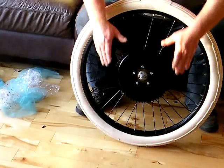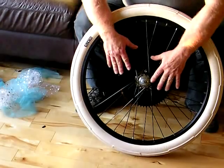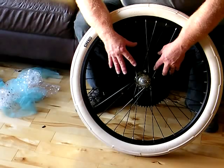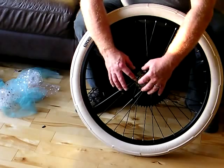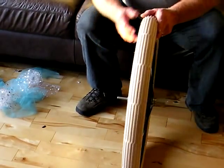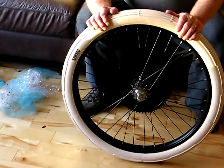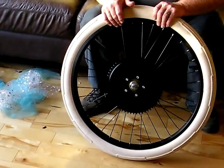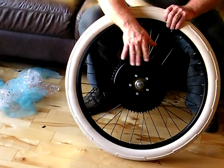These sprockets along with this HD axle kit — and I know there's other stuff on the market — but as far as I'm concerned this is the best one on the market. It is not a piece that clamps on as an afterthought bolted through your spokes. This physically threads onto the hub, does not put pressure on your hub, can't slip, can't slide. If you put this axle kit on there you won't have any problems unless you wear out a freewheel, and if you go with a non-freewheel it'll never be an issue.